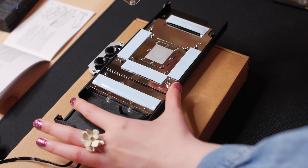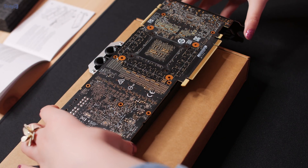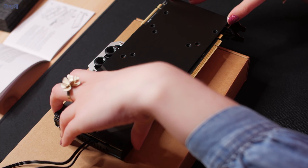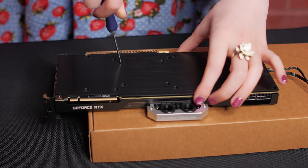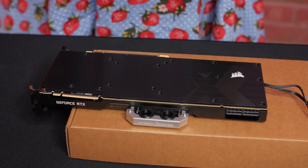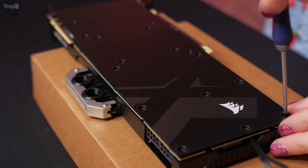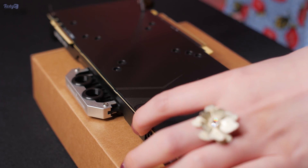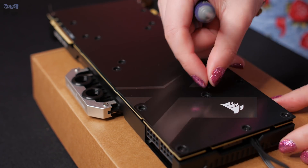I'll link both of these videos in the description down below. I have to say this isn't a huge deal-breaker for me. With most hardline fittings out there, you can actually just pull the tube out without having to untighten anything. So with any water cooling, as long as you're aware of the limitations of the hardware you're using, you can take steps to mitigate risks. I now know that with this block I need to run my tubes in a way that puts little to no tension on that part of the GPU, and if I manage to do that, I'm confident it won't leak. With that said though, if I was spending £150 on a GPU block, this would be a factor that goes against choosing this one.